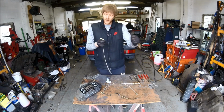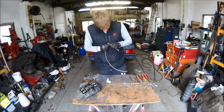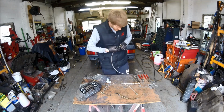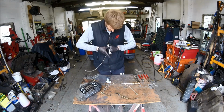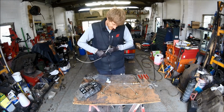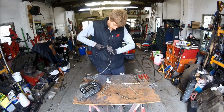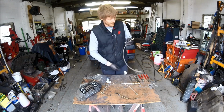So you want to get yourself an 11mm spanner, he said very confidently. Get yourself an 11 and then another 11, hold the pipes together and then turn until it goes tight. You want to only go to where it bites, because if you go any further than that, you could split the pipe or you could bust your fitting and then you're back to square one.